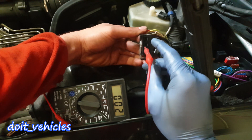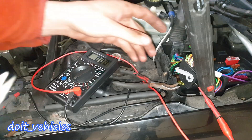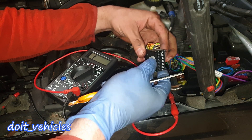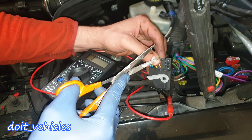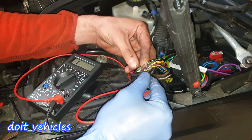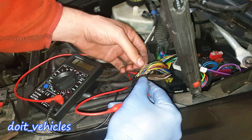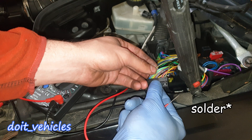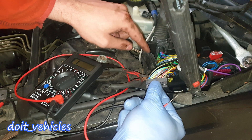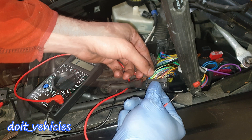You can notice that you can find these pins in different locations — they are not necessarily grouped together. Now let's say one of the pins is short-circuited. You can open this wiring harness and take out the connector. There is a little clip in here which you can press outwards, and then the connector comes out. If a wire is confirmed short-circuited, you can cut it from here and also from down there. Then you weld a new wire on the end of the cut wire. After you finish with the welding and make sure it's smooth, you pull the wire from the other side, which also pulls in the new wire, and therefore you are able to connect it on both connectors — at the PCM and at the sensor.